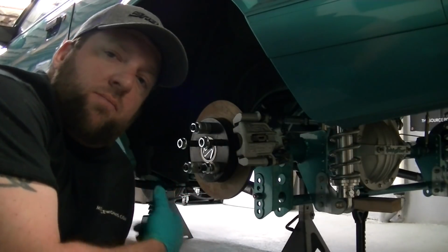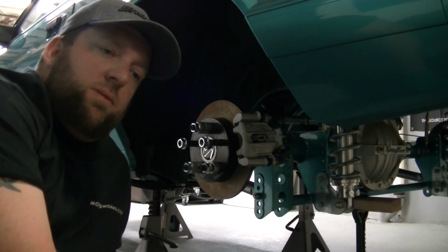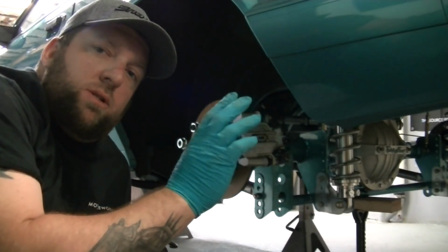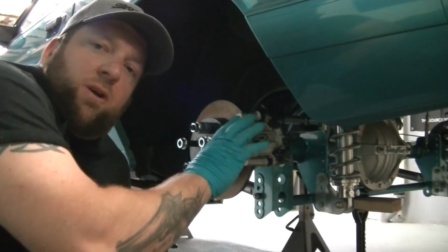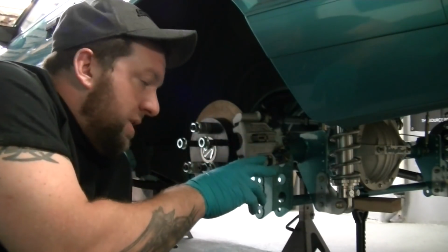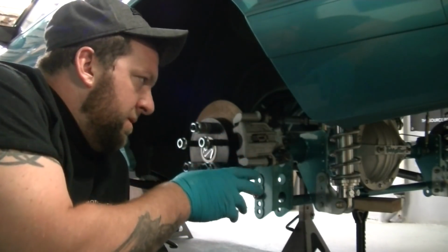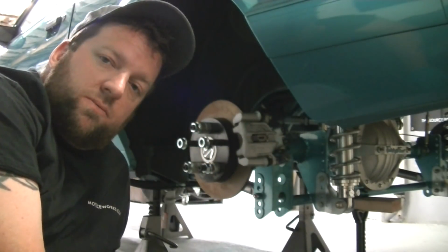I've actually honestly never measured mine. I'm probably going to just measure it right now, see how close we are, and then set your pinion angle, and then you want to rotate your bars evenly. So your pinion angle stays the same, but you try to push this thing over 1/8 of an inch. So if we go 1/8 of an inch that way, it'll be centered, we'll cut that 1/4 inch in half. So it'll be 6 7/8 and 6 7/8. So let's figure that out now.